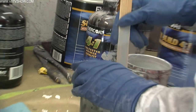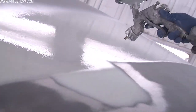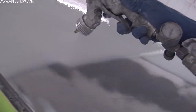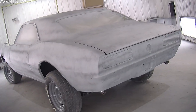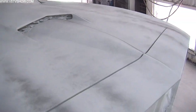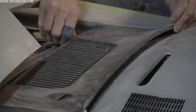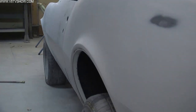We've moved the car into the paint booth, masked it all off, and mixed up the catalyzed 4-to-1 Super Build primer. Nathan sprays the whole car with the sprayable. The sprayable polyester comes out of a gun, so you don't have any pinholes in your final application — pinholes can come from mixing body filler and whipping air bubbles into it. By using the sprayable polyester it lays on without any air bubbles, giving you a nice solid substrate. It also brings 500-hour salt spray corrosion resistance to the whole car, covers sand-through areas, is designed to go direct to metal, and provides yet another layer of corrosion resistance.